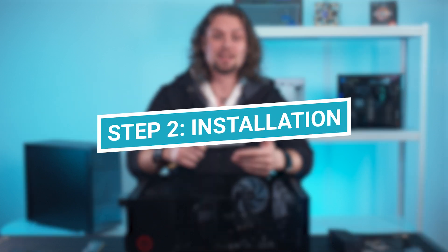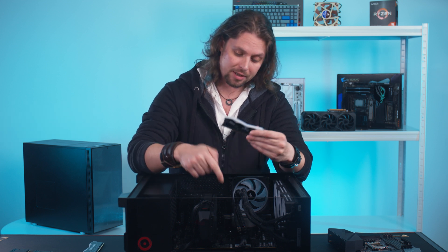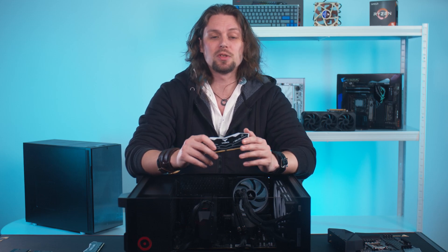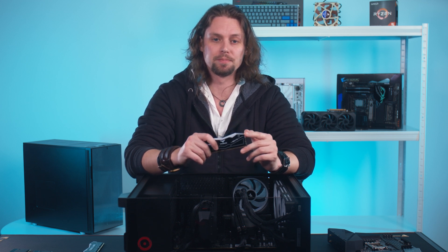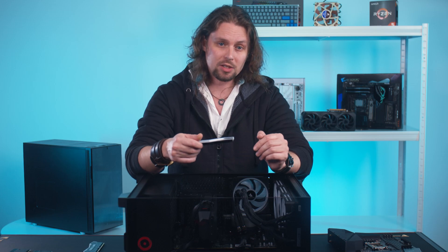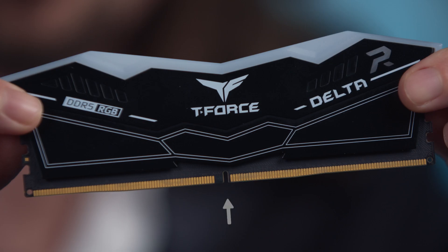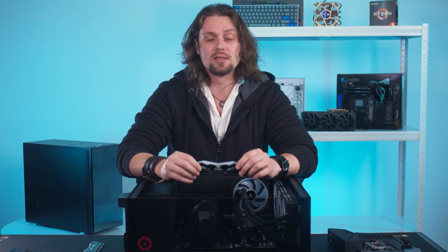Step 2: Installation. The RAM slots on most desktop motherboards will be right next to the CPU socket, and ours are located here. As you can see, this particular motherboard has four slots. We're going to be installing a dual channel RAM kit today, so it's important to check your motherboard's documentation to see exactly which slots to use for dual channel operation. In our case, the slots we want to install in are slots two and four. Either side you'll notice these little plastic clips, and these are the things that will hold our RAM in place. If you hold one of your new RAM modules up, you'll notice there's a notch around about halfway down. If you look inside the socket, you'll see there's a corresponding raised section inside the slot.